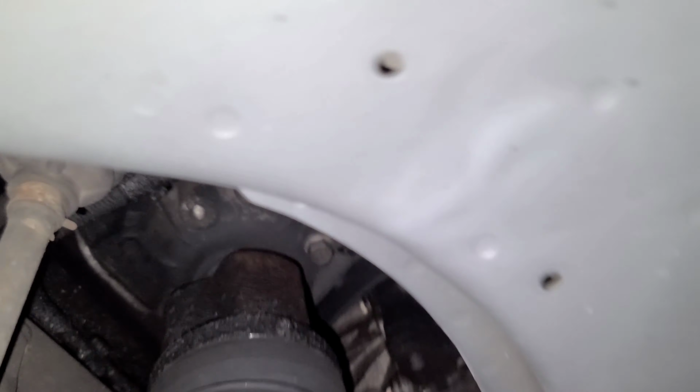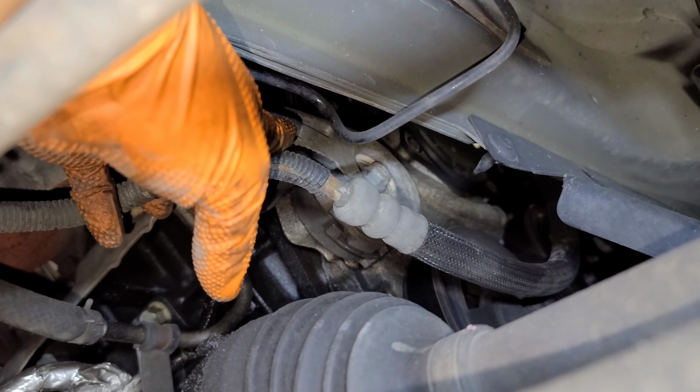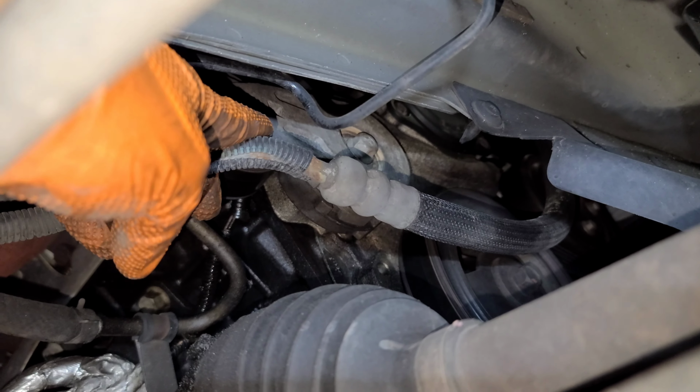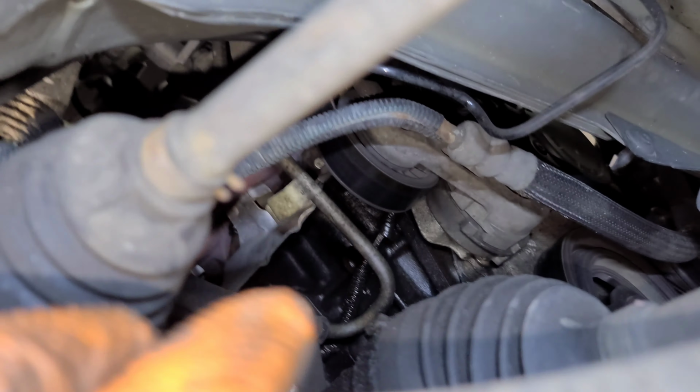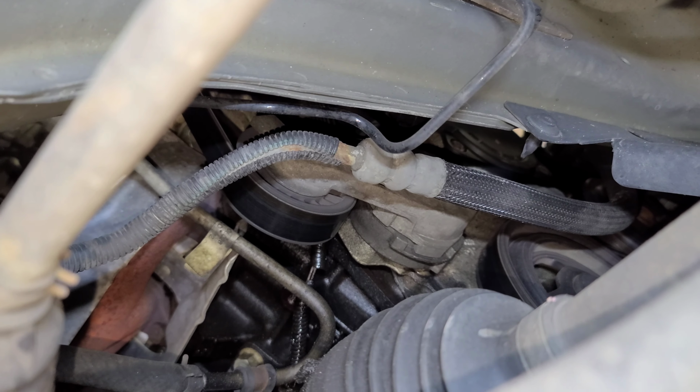Alright, so the belt tensioner is right here, this guy right here. And if you want to get there, you're going to have to come this way, through there, pretty much. If you remove this guy, you see that square? That's where you're gonna put the 3/8 and push it that way, okay? And then the belt is gonna get loose, and that's how you're gonna remove the belt.